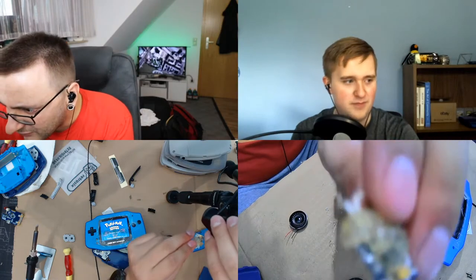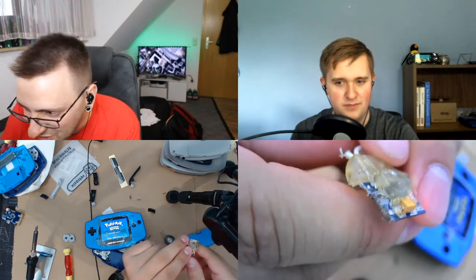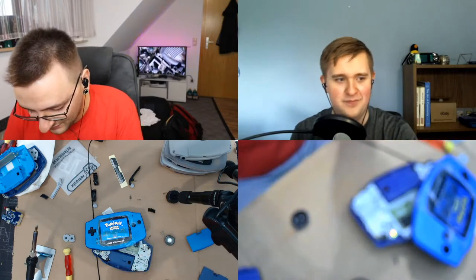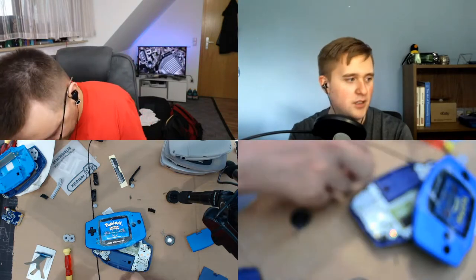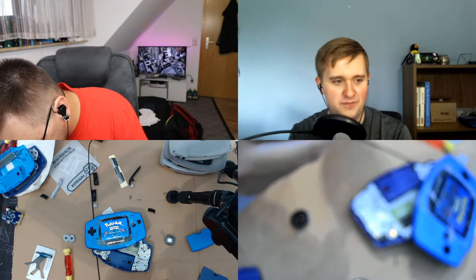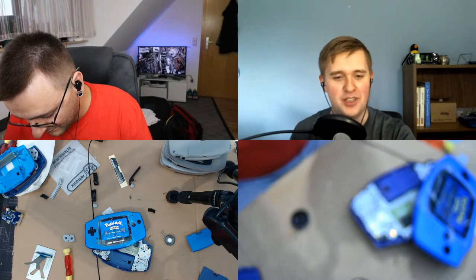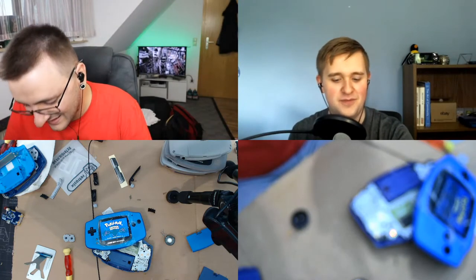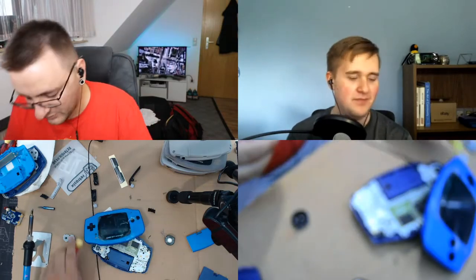The contacts do look fine but they're still covered in hot glue — that's gonna be a pain to remove. Pierre says Mario's got himself some serious gear to work on this project. As usual, it started with 'hey I want a Game Boy,' and then oh, there are other parts for it, and then I ordered all of them, and destroyed some of them, and reordered them. Florian says use a lighter to take the hot glue off. I think the soldering iron is actually more effective. I should probably take this off before the battery runs out.